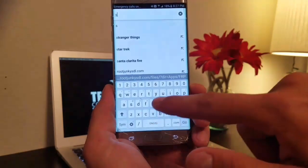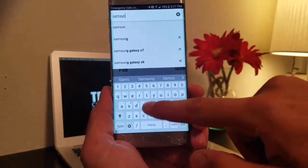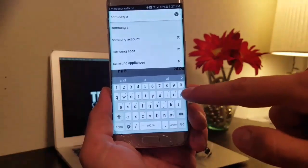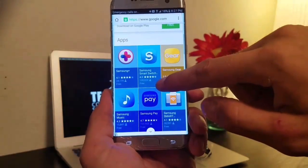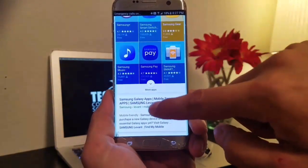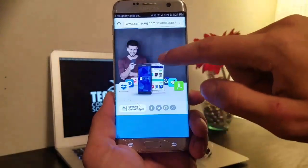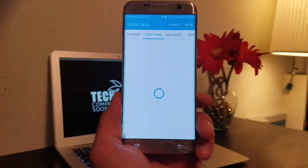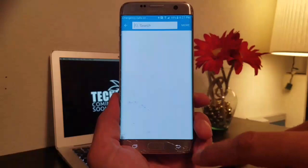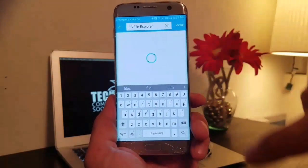Come up top and type in 'Samsung apps.' Go down — don't click those results, they'll put you back to the FRP screen. Click the top link: Samsung Galaxy Apps. Scroll down and select Samsung Galaxy Apps. It's gonna pull you into the Samsung store where we're going to Agree and then search for ES File Explorer.